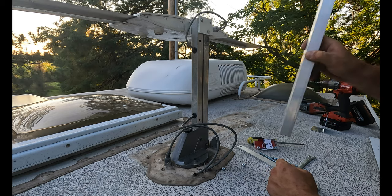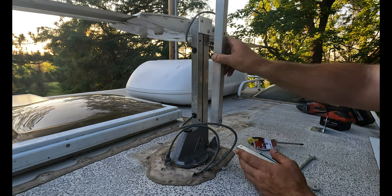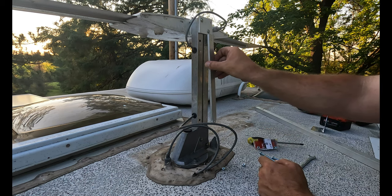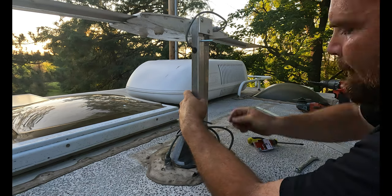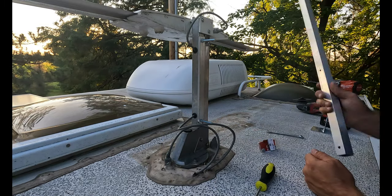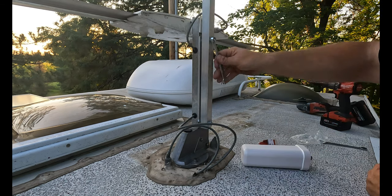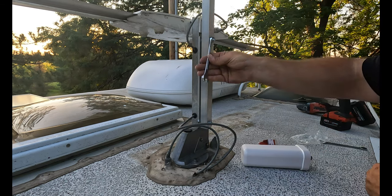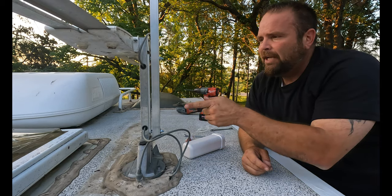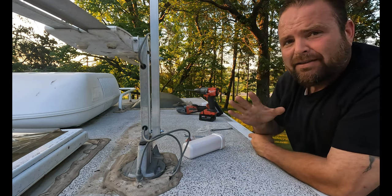Taking a look at the antenna setup, I'm mounting this bar right against the mast, but here's the deal — this mast has to be able to fold down. So first I need to put this flat stock in as a spacer. Once that's in place, I can mount the mast. We'll see if this actually works; this double mast is hinging, so I need to make sure everything can still move freely, and I'm hoping this gap I put in is going to solve all those issues.